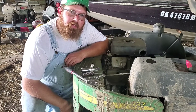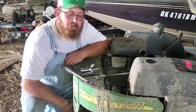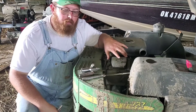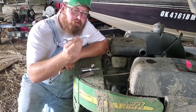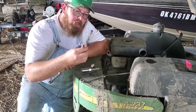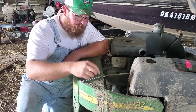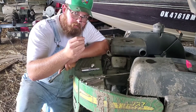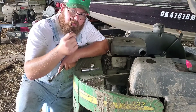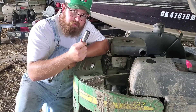Setting the valves sounds a little overwhelming but it's actually pretty simple and it takes relatively few tools that most everyone has. You'll need a 10 millimeter wrench for taking off the valve cover, a 14 millimeter wrench for the retainer nut on the rocker arms, a set of cheap feeler gauges with a 5 thousandths blade, a 3 millimeter Allen wrench, and a 13/16 spark plug socket.